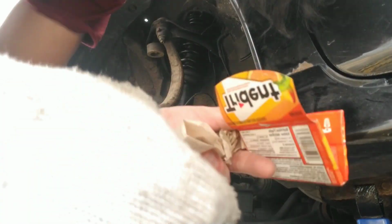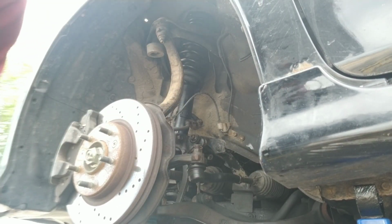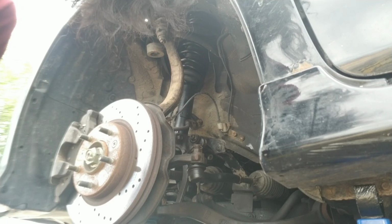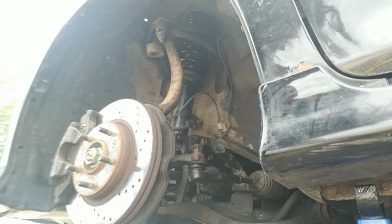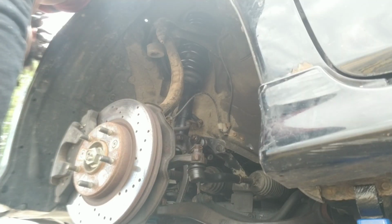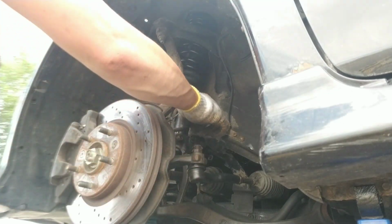So I've got some various Mazda torque settings written down here. We're just going to torque them both down to 40 foot-pounds. The bottom of the fork, I've been told, is 38, so I'm just going to torque it to 40. Sway bar links are about 30, 40. Actually, tie rods are about 30. Sways are 40. 40 foot-pounds, 40 foot-pounds, all right? Okay, one more now. This wishbone down here, the one that I messed up, should be 93 foot-pounds. There it is. 1, 2, 3. And that's tight enough. So we're good.